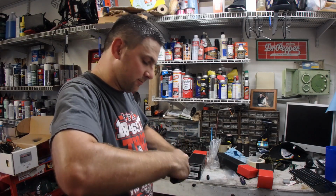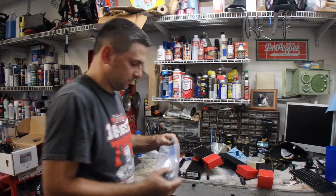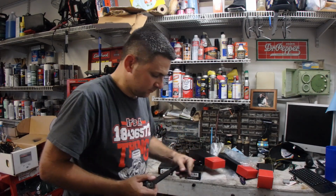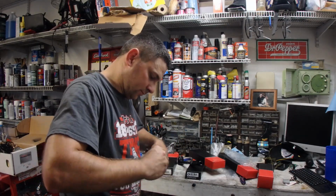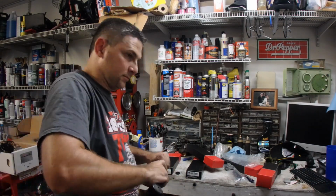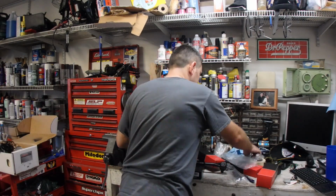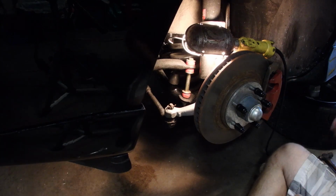It feels really weird. Then you take an outer. Thread the jam nut on it. Now, I like to thread this in. Now, driver's side, you now have a complete tie rod. So I'm going to take a little piece of tape and mark it as such. Now, I'm going to assemble the other side, and I'll meet you guys back under the hood. All right, first things first, we're going to take off the old tie rod ends from the spindle.